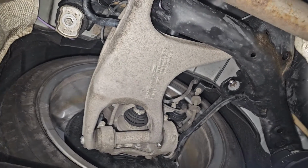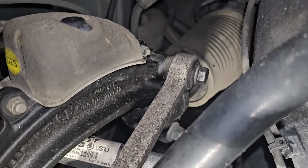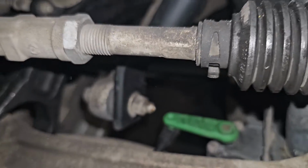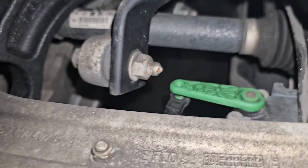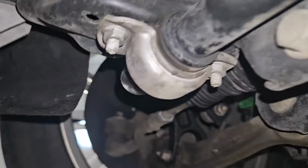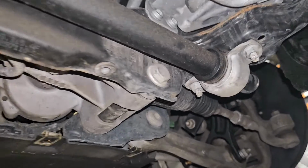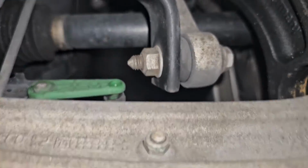We're talking about a vehicle that is all aluminum, let's not forget that, but it's still heavy. There's a lot of weight up front with that V8 and being 17 feet long. Regardless of how you look at it, there's a lot of weight. Not only the air suspension, but the multi-link suspension is known to have issues. If you own one of these cars, you will have to replace these parts at some point of ownership.